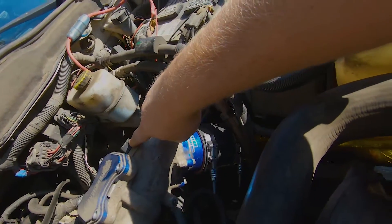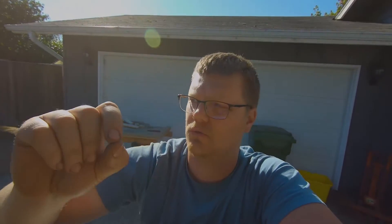Getting back to the MAP sensor — the first thing this did was it allowed the truck to see actual boost over 36 pounds. I don't want to spoil it because this is incentive for you guys to subscribe and comment and have a little bit of fun. I want you guys to know that this truck has stock fuel: stock CP3, stock injectors, AirDog 4G 165 lift pump, the turbo setup I just told you about, head studs, intake and straight exhaust. Go down in the comments below and leave me your best guess on the actual boost this setup makes.